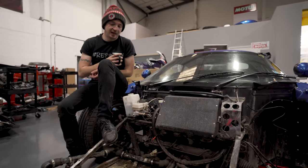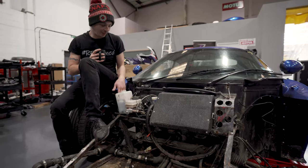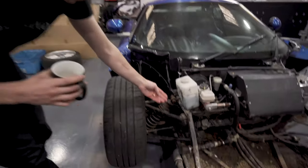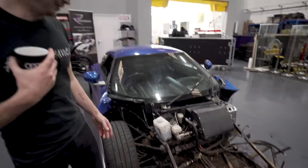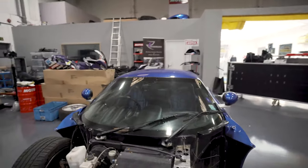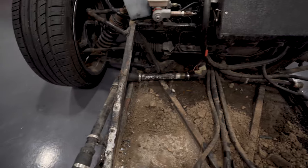The guide plates come at the side. Obviously we've got all the suspension stripped that side. Three of the bolts that hold that plate in up to the bulkhead are behind the suspension mount. Then you can see that side's twisted in — it's got a kink in it. This side has snapped the cross braces off completely.